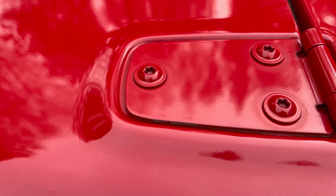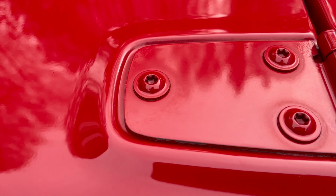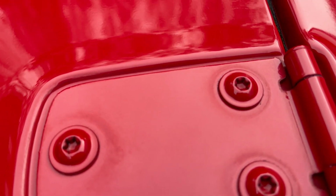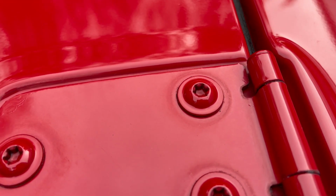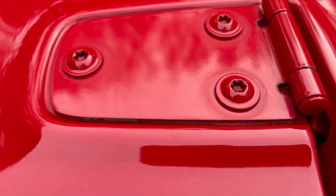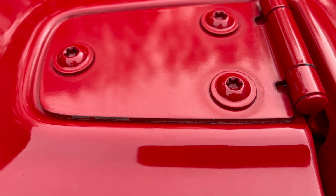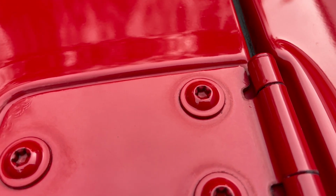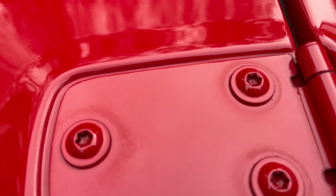It looks amazing. All the dirt is gone without causing scratches. Could we have used the joint brush right away? Sure, but you always want to try the softest, least damaging solution first. The harder the brush you use, the more chance of scratching your paint. The circular stains around the bolts aren't dirt. The paint is etched and needs to be polished out, but we'll cover that in one of the next videos.